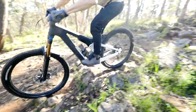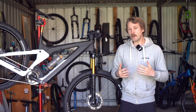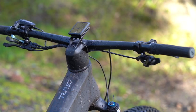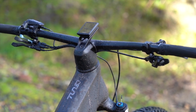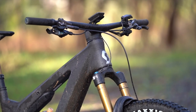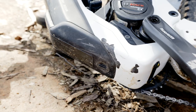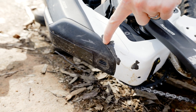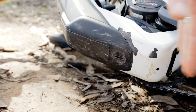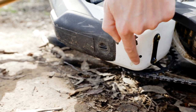I've got some other complaints with the spec on this bike. Both the medium and large frame sizes only get a 150mm stroke dropper post, which I think is too short for a bike that's as big and as capable as this. While the stock setup is comfortable, the integrated cockpit does make adjustments trickier, especially if you wanted a higher front end. A more pressing issue encountered on our test bike was the lack of armoring underneath the downtube. This part of the frame hangs very low due to the battery placement, and unfortunately the plastic guard is quite small, leaving much of the carbon exposed to rock strikes. We'd like to see a more substantial skid plate for this otherwise vulnerable area.